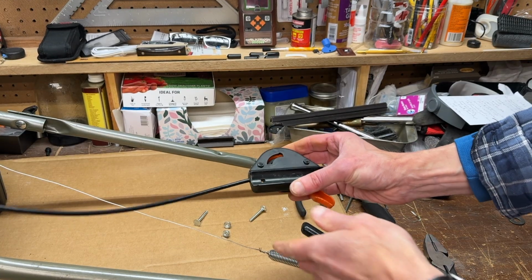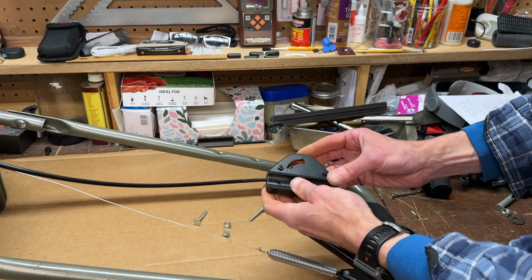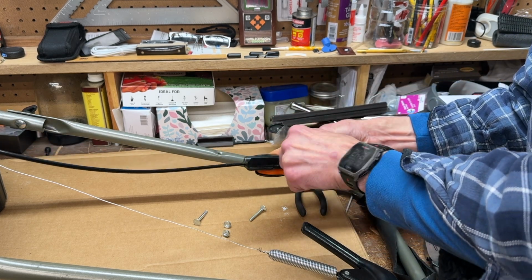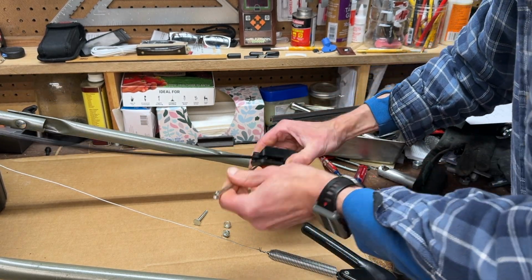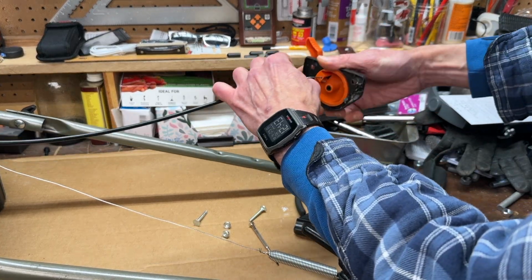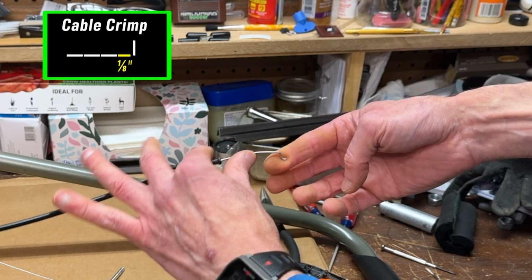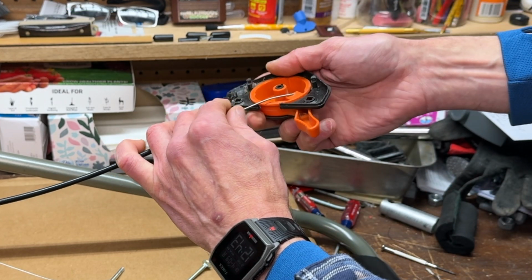To attach the cable inside the handle, you'll need to open it by gently prying the tab with a small flathead screwdriver, and then gently pry around the outside to pop these two tabs. Two screwdrivers makes it easier, but you still want to go easy because the plastic is soft. Once you're in there, to crimp the ends of the cable, use needle nose pliers to make a 90-degree bend upwards 1/8 of an inch from the tip. Move in another 1/8 of an inch and bend the cable downwards 90 degrees. It's the same crimp on the other end as well.